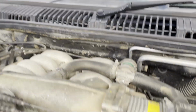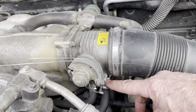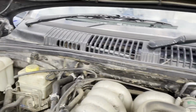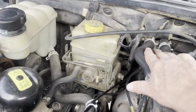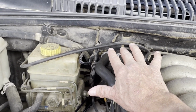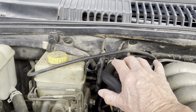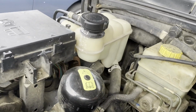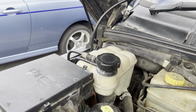Where I was talking about the leaks I used to have was just in there, they used to just weep a wee bit. So now you can see there where I put some stop leak in it, and it stopped that from happening. I also put a new heater matrix in the heater, but I couldn't get it to seal properly when I put it all back together. I noticed that one of these pipes, where it goes through the cab, they go into aluminium pipes, and one of them was damaged where it goes into the heater matrix. So I got replacement pipes out of another wrecked vehicle, put them in, and then new O-rings, but I still couldn't stop it weeping. So the stop leak has fixed that problem as well, and now I don't have any issues at all with it using water. That's the maximum level for the expansion tank. It's been there for months and months and months. It just doesn't use any water at all now, so that's good.